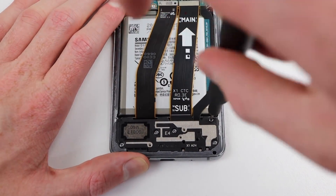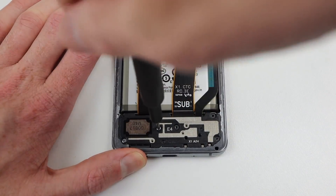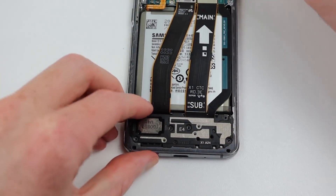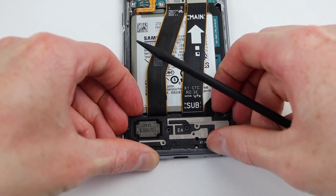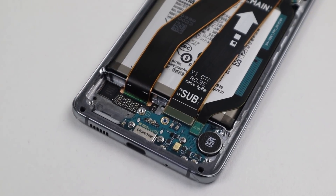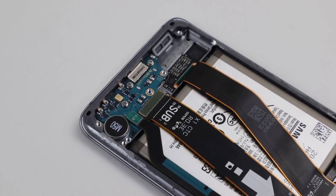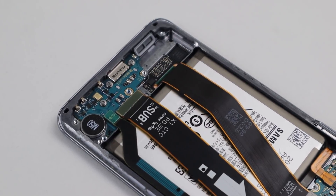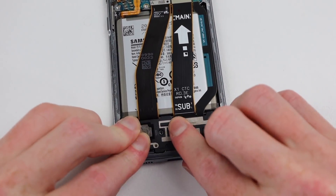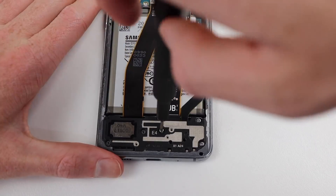Moving down to the lower portion of the phone, I'm going to remove the speaker assembly to see what's going on down there. There are a few cables heading down this way — one is for the display, and the other two go to the charging port board. So, is the charging port replaceable? Well, yes it is. It is on its own separate daughterboard which can be easily unscrewed and replaced if necessary. This wasn't seen on the 4G models of the Galaxy S10, which have soldered-in USB-C charging ports. So I am happy to see that change with this Galaxy S20.